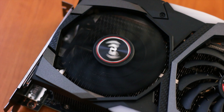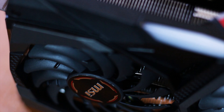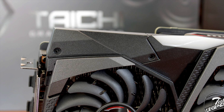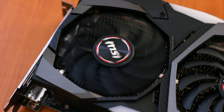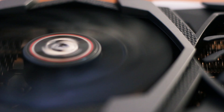The usage of different fan sizes in this particular case is not to improve cooling performance, but to allow access to the Nvidia NVLink connector found on the left side of the graphics card. In other words, a 95mm fan would have blocked the NVLink connector, but the smaller 85mm fan allows for just enough space to be used. Speaking of the NVLink connector, in order to use it properly a plastic plate has to be removed from the graphics card — luckily this plate is only held in place by two screws.